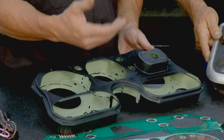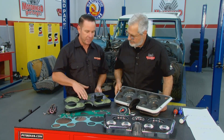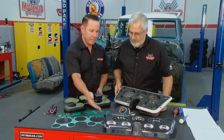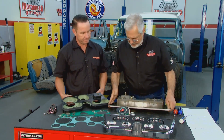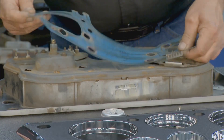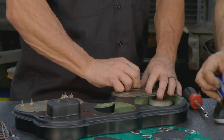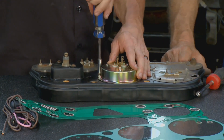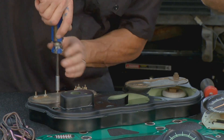What we're going to do today is put in the tach conversion that Brothers makes. We offer a tach conversion or all the parts to put a stock one back together if you don't want a tach. This will give you the housing with the cutout for the tach, a factory-style tach, factory-style printed circuit, a brand new lens, and a brand new bezel. First thing we're going to do is take this apart — remove the nuts retaining the printed circuit board to the gauges and take out all your bulb sockets.